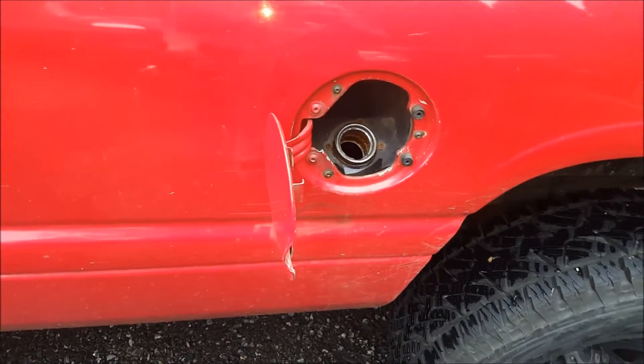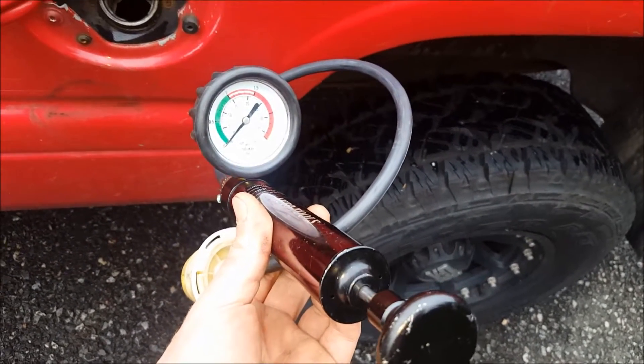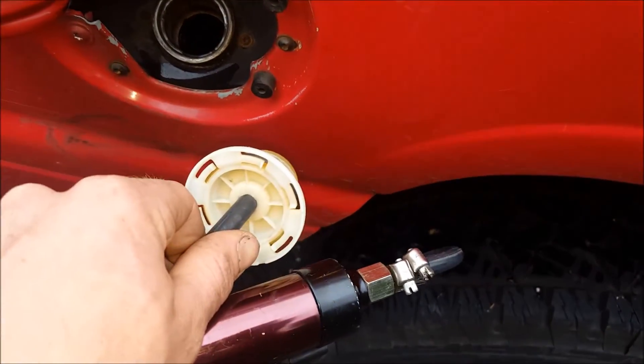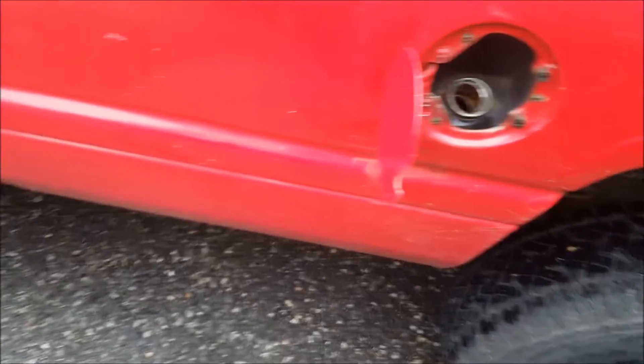There are probably a lot of ways to check this, but the way I'm going to try is I have a coolant pressure tester that goes up to about 15-20 PSI. I took an old fuel cap, took the back off, drilled it out, and put a hose in it — so I'm going to thread that in and pressurize the tank. It took quite a bit of pumping to get some pressure, but I can hear an air leak now — that's probably the vent up top. That turned out to be the tank vent, so I'm going to cap that off.